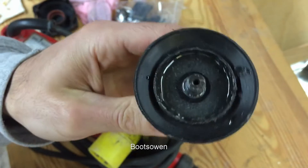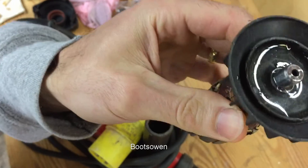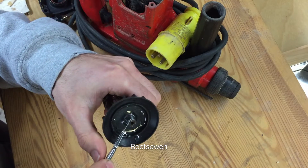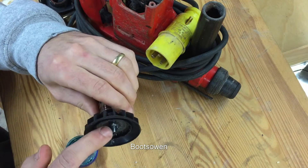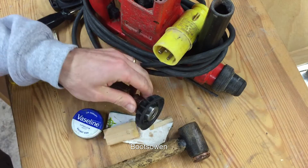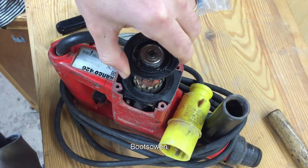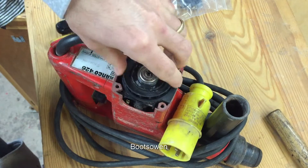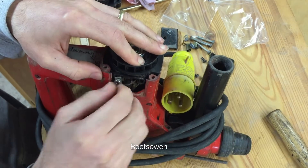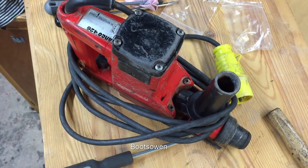It feels like I've been playing around with this thing for ages — out at it maybe four or five different times between waiting for bearings to come and that kind of stuff. Now the glue has gone off. I'm not going to try and force it off, just leave it there. I'll get the bearing onto that little shaft — it needs a bit of a clean up — then press the bearing on. A little bit of epoxy on the shaft, cleaning it with an X-Acto knife. A tiny bit of grease onto the shaft just to help the bearing on. Using a socket just big enough to chase the inside race, we drop this in and hopefully it spins freely. Yeah, it looks pretty good. The brush goes in on the side, the cable slides on, and we're all back together.